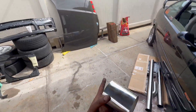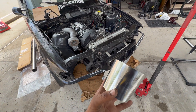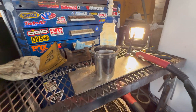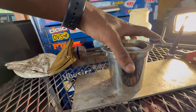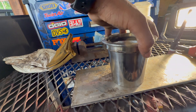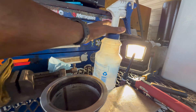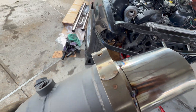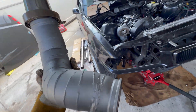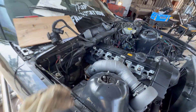It's kind of windy today so we'll see if I can get a little spot where the wind won't blow away my shielding gas. It's time to weld. Got my reducer cone and my v-band to go onto my downpipe. I'm gonna see if I can weld this on here somewhat decently — prepped it with some mineral spirits. Reducer's tacked on in a few places. Going to throw this back in the car and start fabbing up underneath.